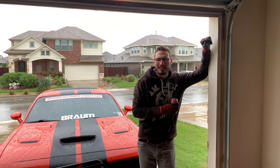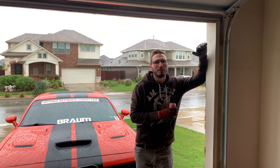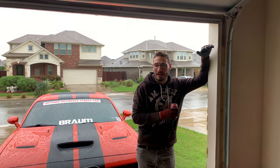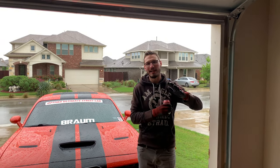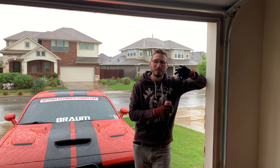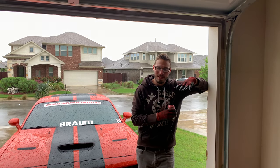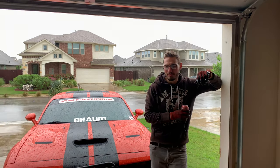Oh, we definitely can get it to tuck in. I mean, it's 315 right now, but if you were to go down to a 295 and bring that sidewall down to a 35 or a 30, you'd get a nice slant that would line up good with the fender. And you know that really aggressive stance. You'd probably still have a bit of poke, but it would look good. I mean, I've seen Hellcats running this same kind of size setup. It doesn't bother a lot of people, so.